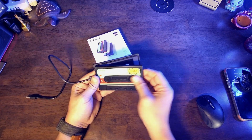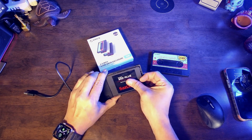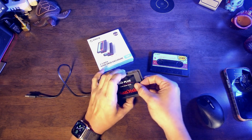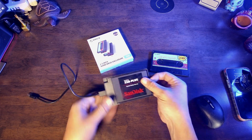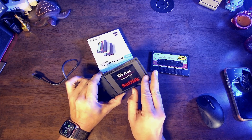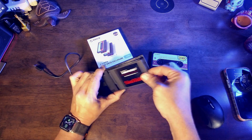One thing to note is that I do find it just a little bit squirrely to try to get these hard drives out of here. Maybe I'm not doing it in the correct way, but you basically have to angle it up in order to get a handhold on it. You can see I'm struggling a little tiny bit, and it makes you a little bit nervous because you feel like you don't want to damage your hard drive in any way. But what I find is that it likes to hook on the little bottom part down here, so if you kind of pull it up and away from that, then you have plenty of space to grab the hard drive and pull it out.